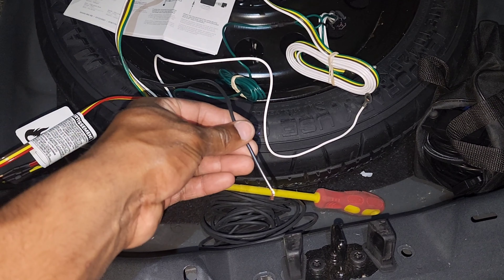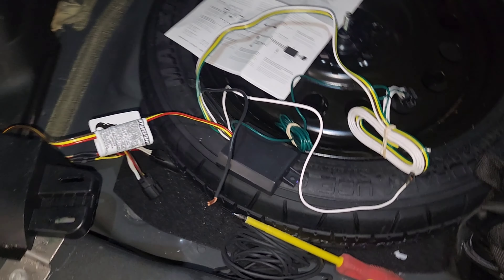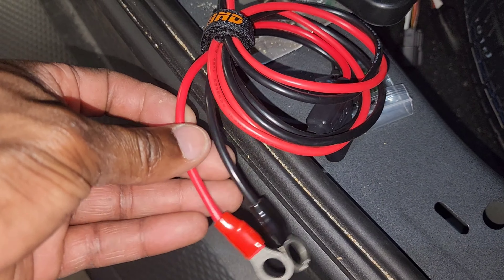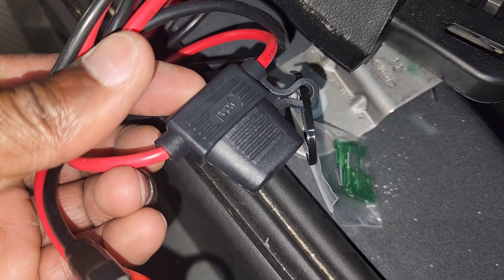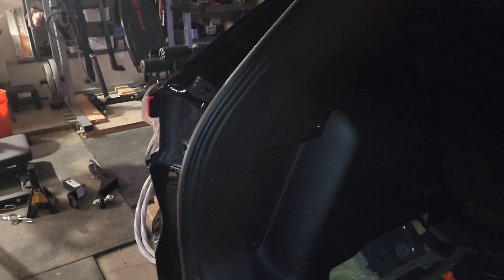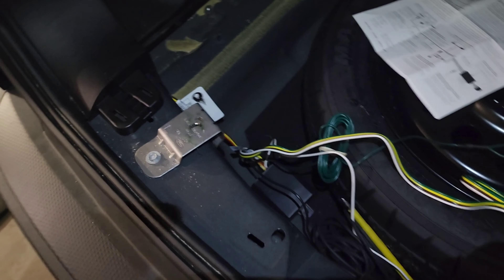There's the other side, and of course you also need power - 12 volts from your battery. But I'm going to do something different in this tutorial, which I felt was a much better idea. I'm actually going to plug up to that cigarette lighter if you have one. I'm going to be using this black wire with the fuse - this is actually going to power the trailer lights, which is only a few amps, so it should be sufficient.